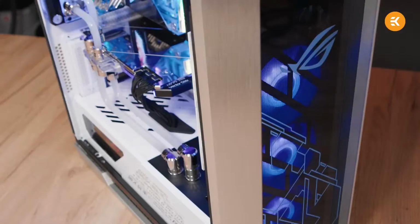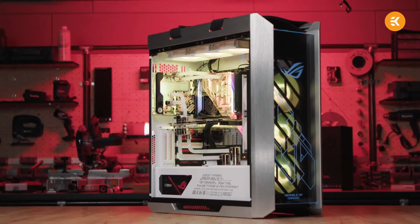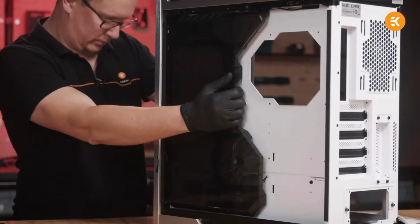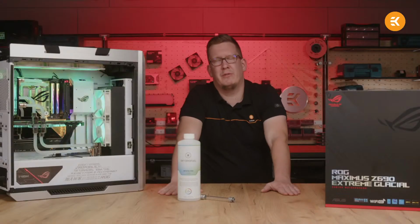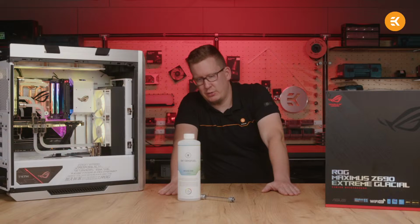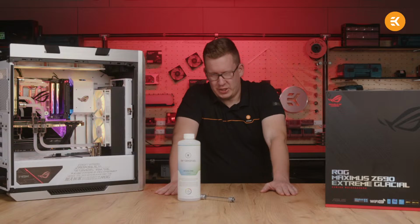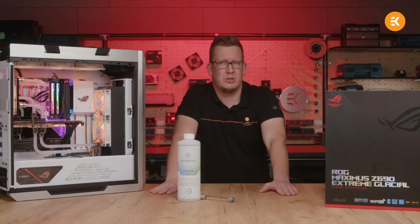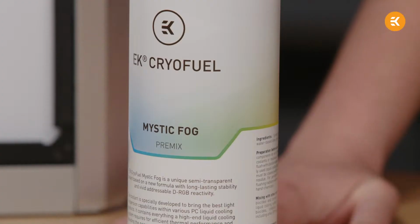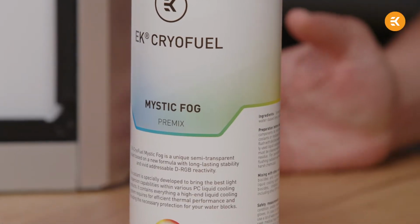Are the coolants you sell on the website the same performance wise? Yes. The coolants offer the exact same performance, it is the same mixture. The amount of particles inside the coolant has a negligible effect on the performance. Actually, these coolants have slightly worse performance than distilled water, because all of the additives inside it are slightly lowering thermal transfer.